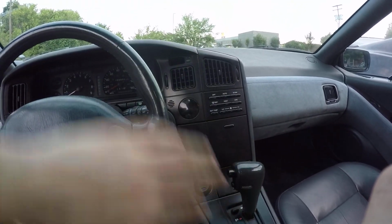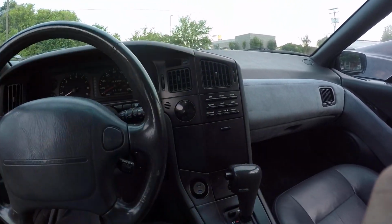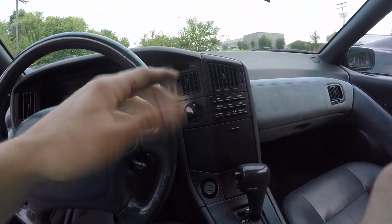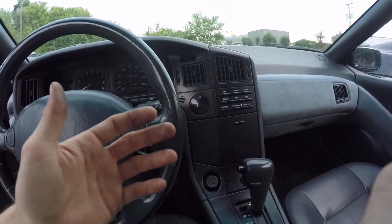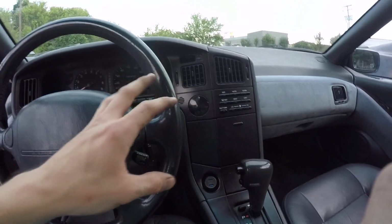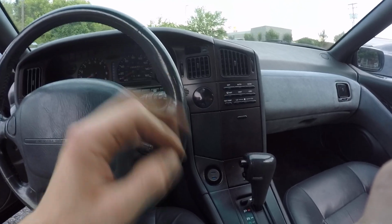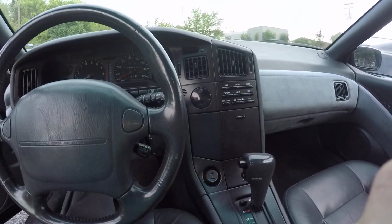What we're gonna do is pull the whole assembly out. The motor and trans, keep them connected, pull them all out together. Do a complete reseal on the motor. That way it's good. I mean, it's only at 99,000 miles, but it's also almost 30 years old. So fresh gaskets on the motor, new plugs, basically a whole tune-up on this car, so when it's running, it's running as mint as possible. So we'll get that going.